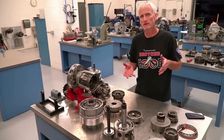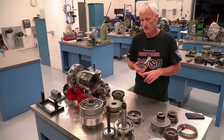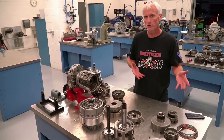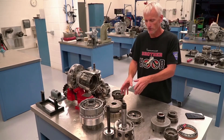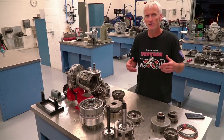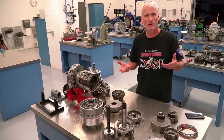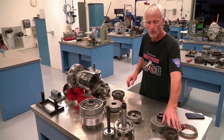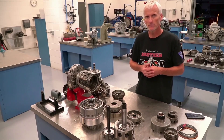When we talk about planetary gear sets with a part that's input, a part that's held, and a part that's output, now you get an idea of what's doing the holding and what's doing the driving. We've got clutch assemblies, one-way clutches, and bands — in the case of a clutch or a one-way clutch, they can either hold or drive a part; in the case of a band, they're only going to be holding a part.